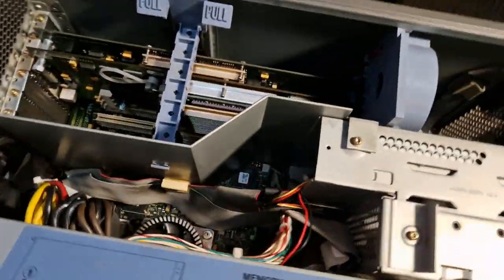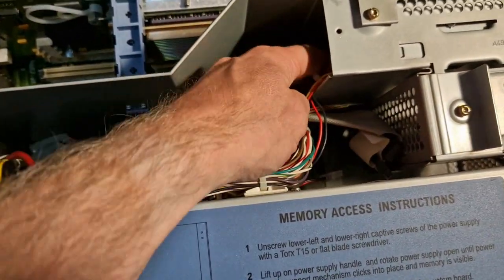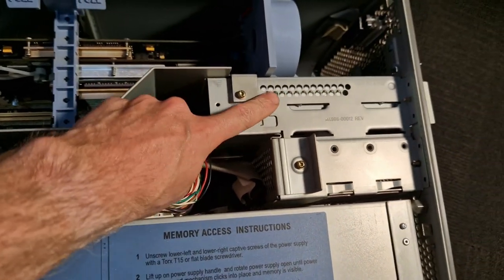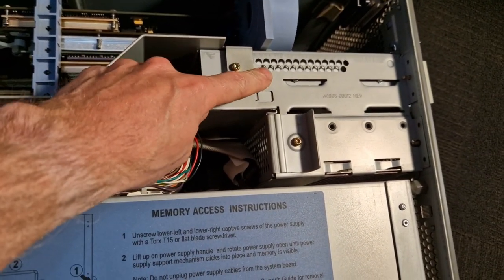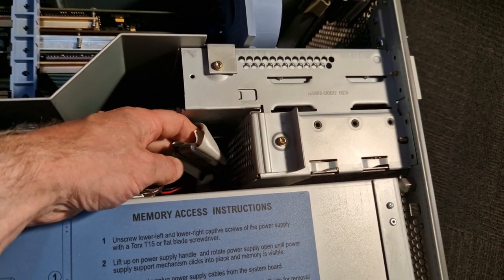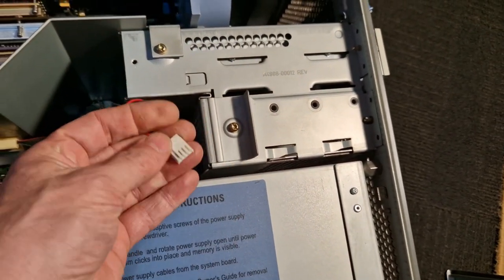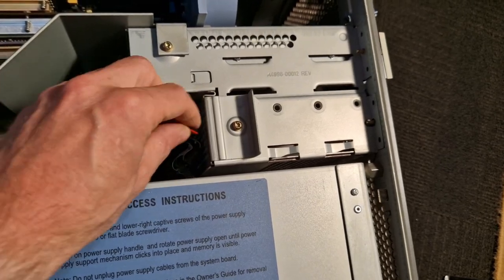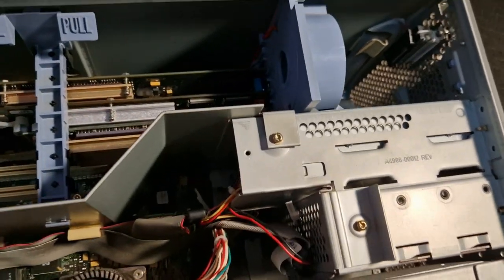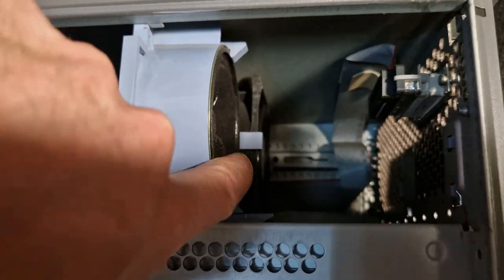and you can see here some ribbon cables that go to the DVD or CD-ROM drive, which I forgot to mention actually isn't SCSI, it's parallel ATA, so you can get cheap replacements from the PC types, and there's a ribbon cable here which is the floppy if there was one installed with its power connector. I don't know, maybe fun to get one just for that. Just to make it complete. In the top here we've got another fan and a loudspeaker